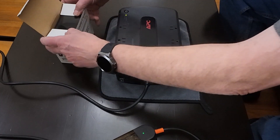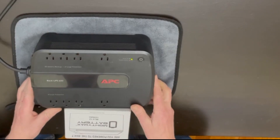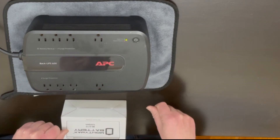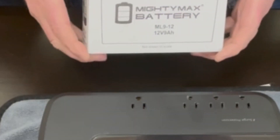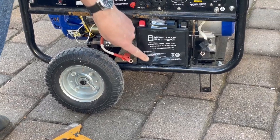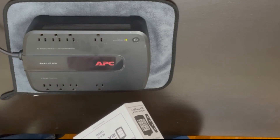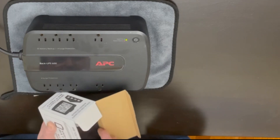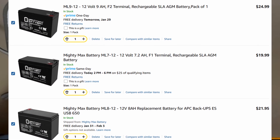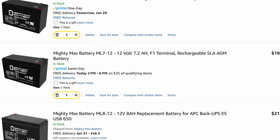So I ordered a new battery from Mighty Max. The reason I got this one is because it's a lot cheaper than the APC. If this was in a corporation, I'd recommend you get the APC batteries because — 14 years — that's a pretty good track record. I also got this brand because I have one on a small generator and it's been working very well; I've gone three-month periods and started it up and it's worked fine. Even though it's Mighty Max, they have different ones. This one is 9 amp-hours, and they also have an 8 amp-hour and a 7 amp-hour. The difference is about $5 each, so I figured get the bigger capacity one — it's probably going to last longer when the power goes out.